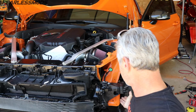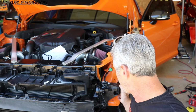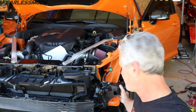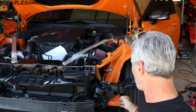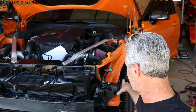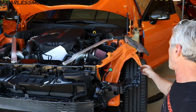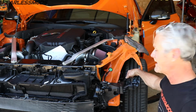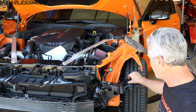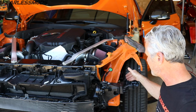Okay, so all I did was on this outer flange here, I stuck one washer back here that gave me a full 1/8 of an inch of bringing this forward, which brings this with it. It's a little further out, so it'll be slightly more than an 1/8 of an inch. I did mark over here so I could see how far forward it came. So that went a little more than an 1/8 of an inch, and then I put a washer behind here to get me out to about a 1/4 inch total movement forward.